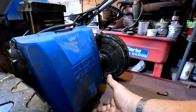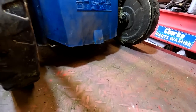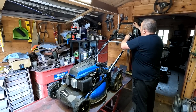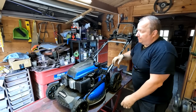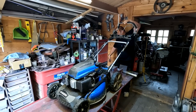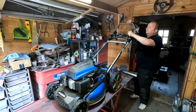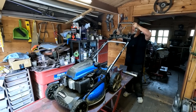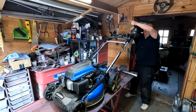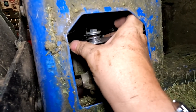I'll try and give it a start up. I've left the rear trap door open at the back just so I can see if anything comes off. Make sure you do clear up anything under your lawnmower folks, because in a previous video a spanner nearly got sucked in. Starting from cold — better put the spark plug cap back on otherwise it ain't gonna fire. Pull the dead man handle up... no drive. That variable pulley seems to be a bit slack to be honest.